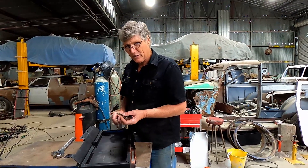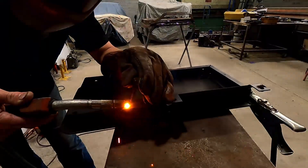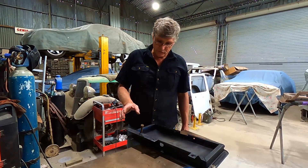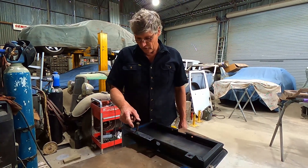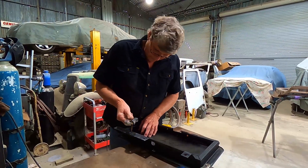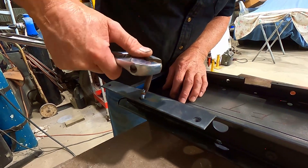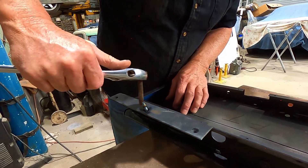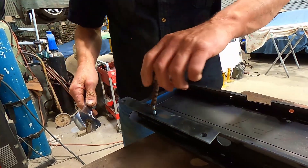So we'll just weld this on to the other piece and hopefully it'll come out just as nicely. I'm not that fussy about letting this one cool down as much because we've already got a bit of heat down there. All we want is the weld to cool enough to be strong enough to bite onto our previous piece of weld. It snaps off, we can always do it again. Just felt the little spot where it loosened. Now we can rock it — the rocking motion actually breaks the rust up, powders it. I can feel it binding again, but now we've got it — it's loose, it'll come out.